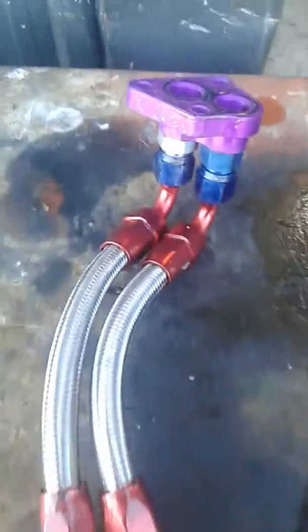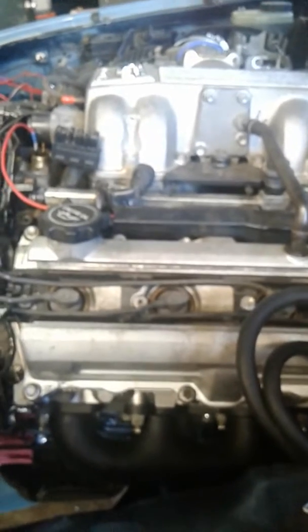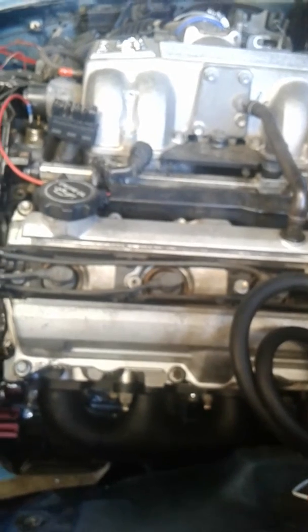We changed it over and it came up with good oil pressure. With a new switch in it, the anodizing on this one was so strong it didn't actually earth through it, which was really interesting. We ended up swapping it on this truck to a filter housing where the filter goes forward, so there's no mistaking it — it just bolts on, all correct, neat and tidy. Please be aware of remote oil filters; I've seen too many motors destroyed because people connect them up wrong.